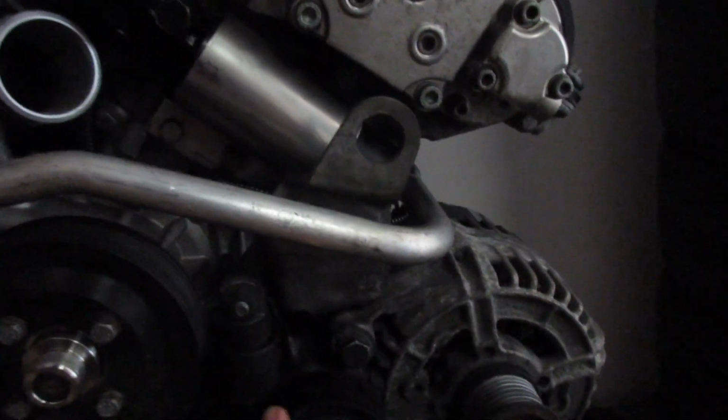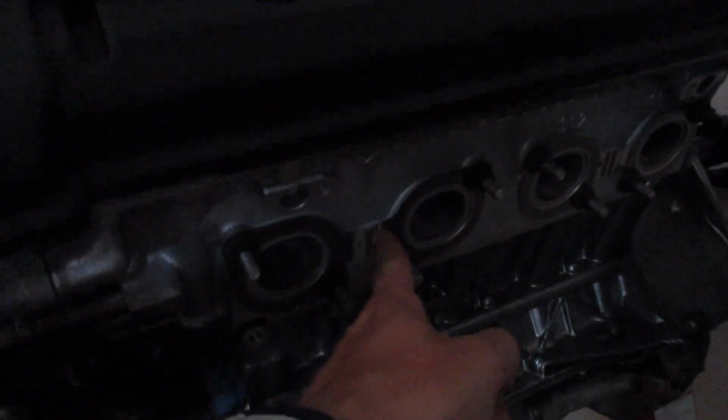And the pulleys. No power steering pump yet. That's going to go there. Those pulleys might need to be replaced at some point. Thermostat housing's on there. I imagine the thermostat's inside. The fan clutch is going to go here on the new water pump. He's replaced, I think it was the other side, but some of these studs had sheared off. It's got new studs in there. I see some new exhaust gaskets, and the nuts are even threaded on there to hold those in place. These are the ones that were replaced.